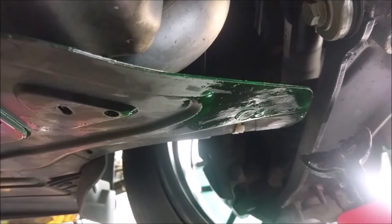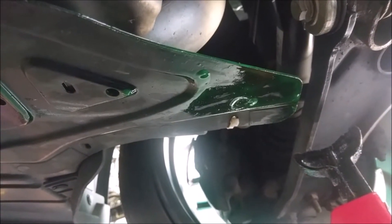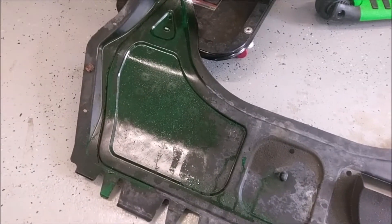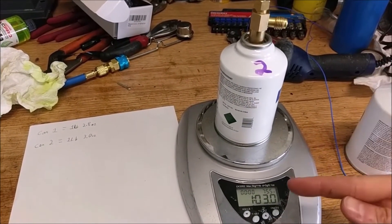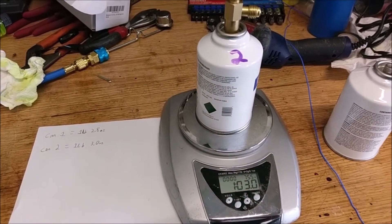It's probably worth about three-quarters of an ounce of refrigerant oil just right there. We're definitely going to add about three ounces to this system. More refrigerant oil — this stuff was going everywhere. Go to weigh your cans. Make sure you have the adapter on so you get your starting weights correct. Recording for both cans so you can charge it by weight.